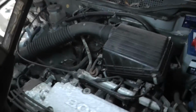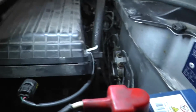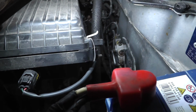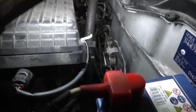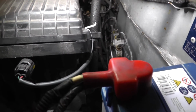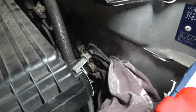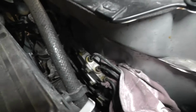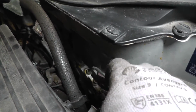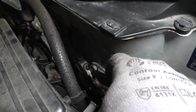And this over here, down here, is moving as well. The one that's a little bit shiny, it's got the WD-40 on it, so that's fine. So now there's nothing really holding this lining, apart from obviously those two connections. Left myself with what should be an easy-ish job, and it's just to take off this pipe here. So there's nothing else holding onto the car apart from this connection and down next to where the drum brake is.